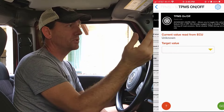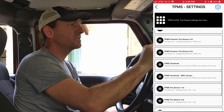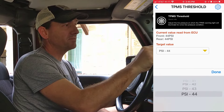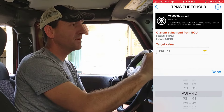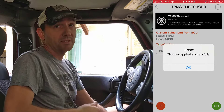One simple option is TPMS on/off, which is great if you're off-roading and you air down your tires. But what I found is if you scroll down a little further there's this TPMS threshold. When I first pulled this up it showed front and rear at either 0 or 99 — not valid settings. To show you how to fix it, I set it to 44 to trigger the low pressure warning. But let's set it to something valid, like 29 PSI — a typical reading. I click done, then hit go, and it reprograms the system to look for normal pressure levels. For a $15 license for OBD Jscan and a $30 adapter from Amazon, I was able to fix something I'd been trying to fix everywhere. Hopefully some of you have a similar problem and this can help you fix your Jeep.